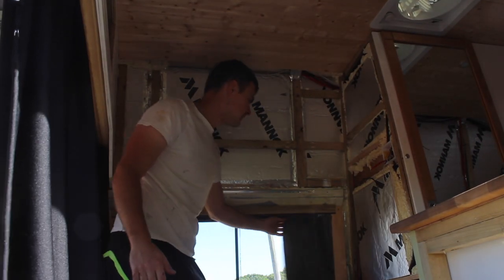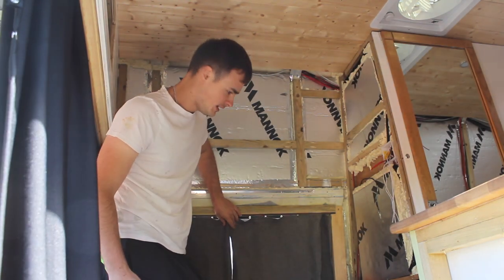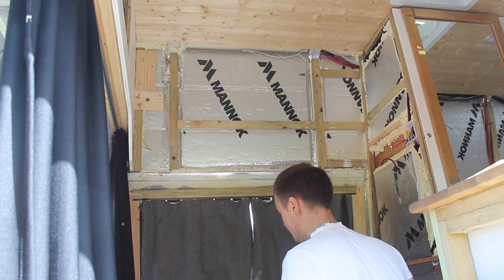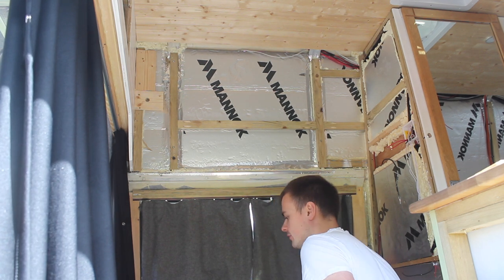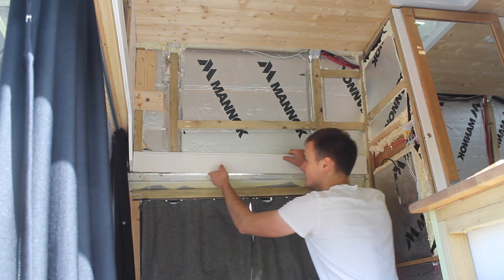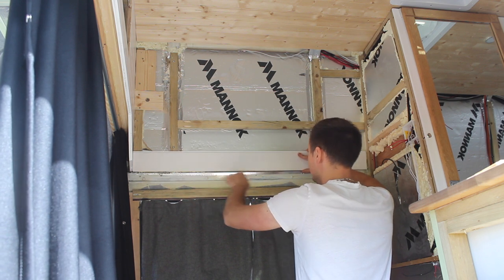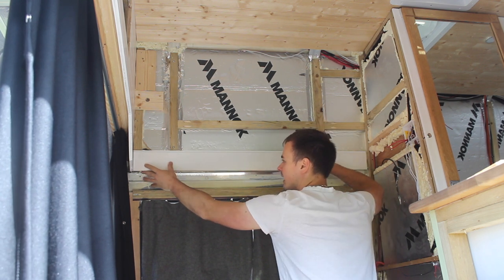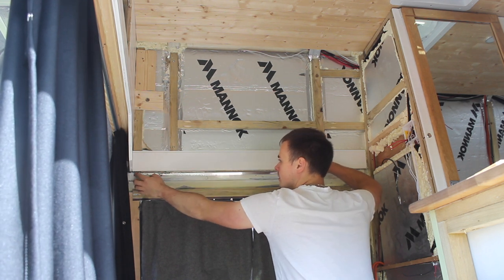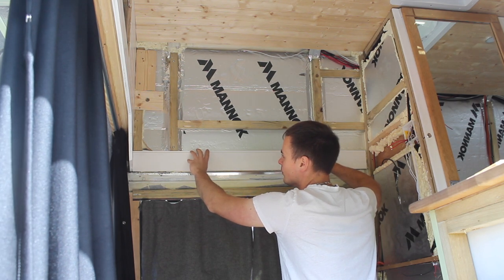Curtains. If I can draw these, and you might be able to see a bit better. How's that? With a van, there's no using levels. You have to do it by reference points. So for this piece of cladding here, my reference point is going to be this ledge across the top, and that is what I've been using around the van for doing this as well. This ledge is the reference point I've used to keep everything level.